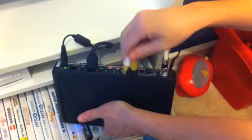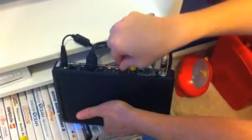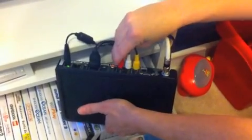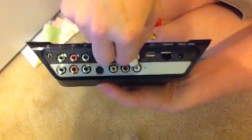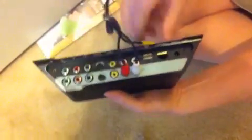To get the best quality video, you should use S-Video, but in our case we're using the old three-cable RCA cables. So just plug the three cables into the output of your cable box, then plug the other end of the cables into the input of the Slingbox device.